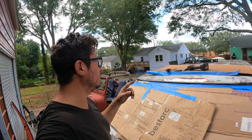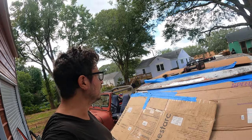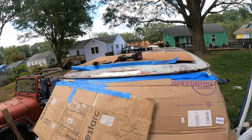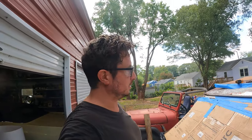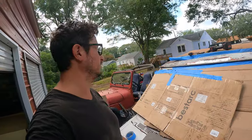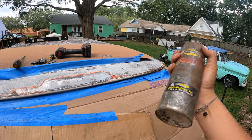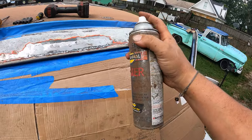That was no fun — probably took about an hour. It's probably screaming hot right now. I can't say it's my best work, but it's pretty darn good for what it is. Fewer holes though, so I'll nail it with some primer, cover it with some textured Kilz outdoor in van color and move right along. The can's a little weathered, but this is a bare metal slash rusty metal primer. Not terrible, not high-dollar work either. If we didn't stop our leak, we certainly slowed her down.